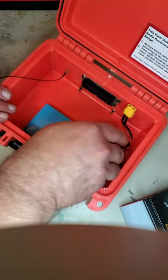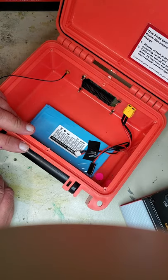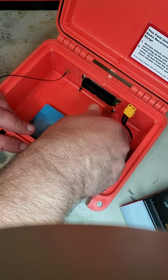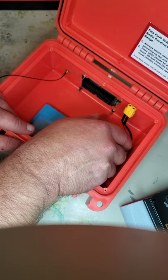And the battery. This is a very old one that has a very old battery in it, but the process is the same. They're going to be attached with foam tape and sometimes some Kapton, and they don't stick particularly well to the plastic.